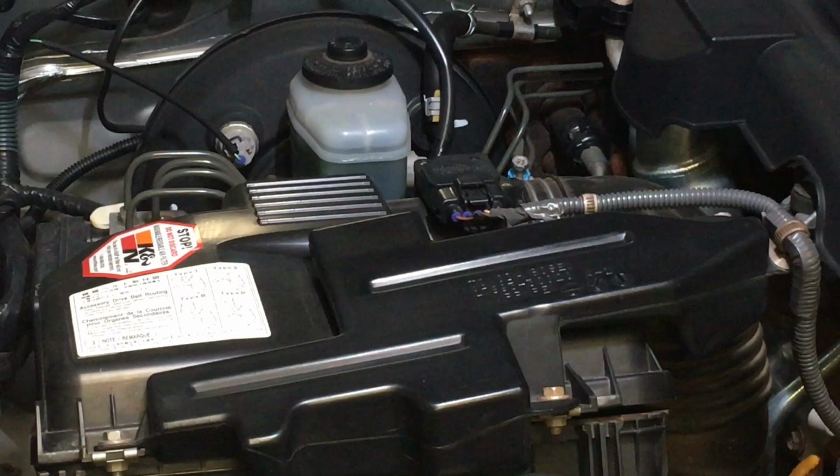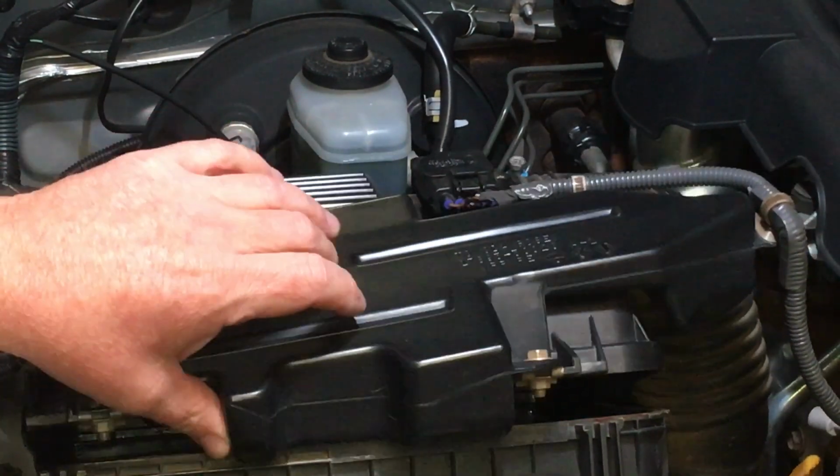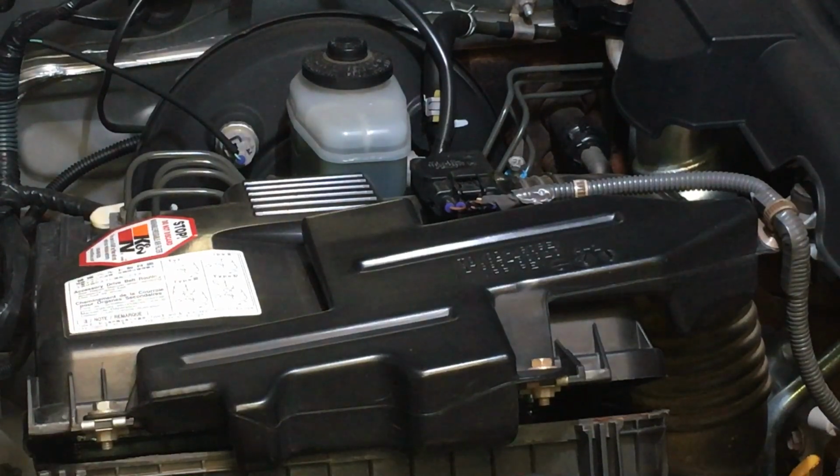But look, with all air filters, once it gets to a certain point, the engine's not going to stop running. When we had that really blocked air filter, it was still running and blew no smoke. Whereas when we ran paper filters on that same vehicle and were out for a couple of day trips in a lot of dust in summer, it would only take a few day trips, maybe half a dozen, and the vehicle would be blowing smoke. So you'd check your air filter and find, look at all the dust in there.